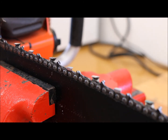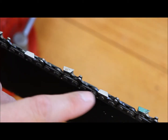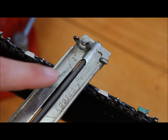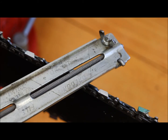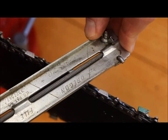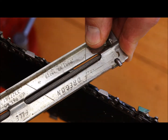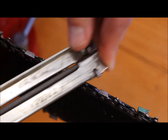From a different angle you can see the next tooth. Obviously some teeth you can't do from this side because the angle goes the other way — that's when you flip the bar around and catch those on the other side. So for the next tooth, you line up the relevant guide line parallel with the bar and keep your 10-degree tip down.